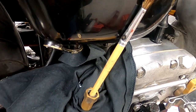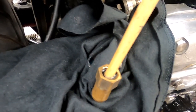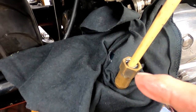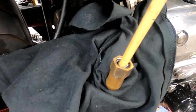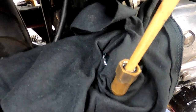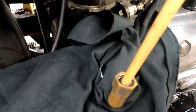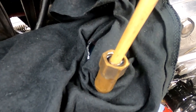I've just trimmed a small paintbrush, which is a nice diameter — it's a slight taper and it's going to fill this hole. That will stop the column of oil, which is already ever so slightly starting to disappear. By tomorrow, that will all have drained away into the crank casing and this tube will be full of air, which will be a problem. By sealing it up here, the tube will stay filled with oil and I'll be able to deal with it tomorrow morning.